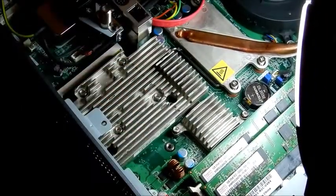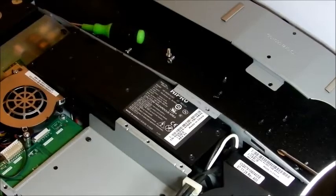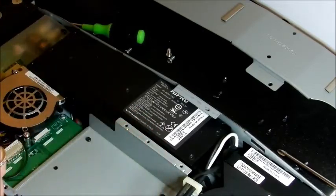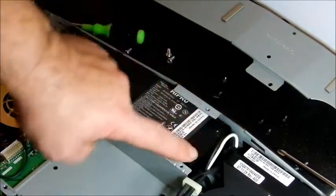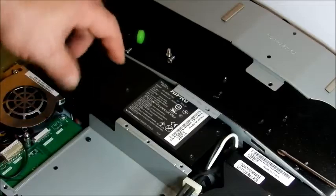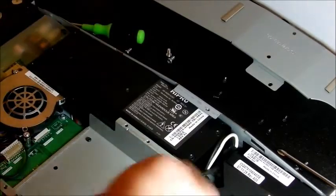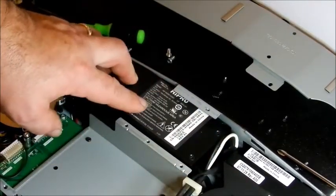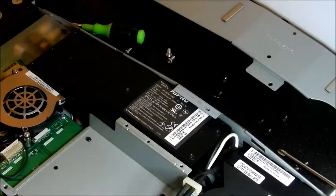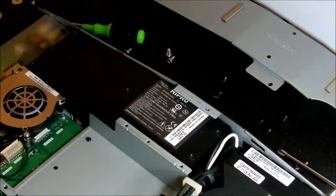Okay, that's the video card. This is the power supply up here. The cables over here were kind of in the way of the hard drive — they run from where you hook up your power up here. There are one, two, three, four, five screws to take out. When you take this out, you need to lift this end up and pull it that way because there are brackets — you can't pull it straight out. This is a proprietary item to this computer — it has a down slope on this side to match the figure of the whole computer, so you'd have to purchase it from Dell or eBay, and it's probably going to be expensive.